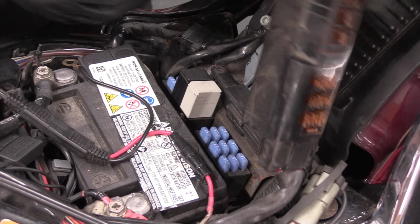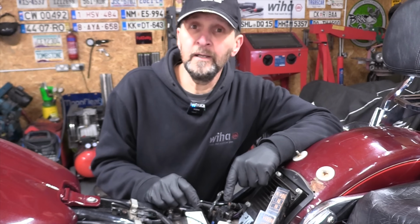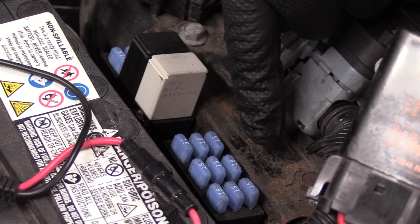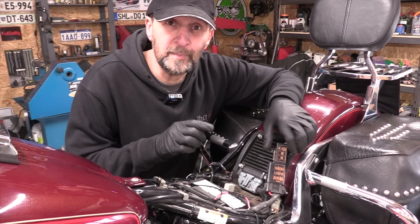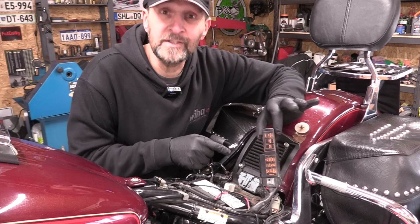Lift it up out the way. Now what we're looking for is the bike's main fuse, and it's not in there. All we've got is 9 15 amp fuses for all the bike's bits and pieces, the horn, the ignition, the lights, etc. A starter relay, a system relay. It isn't in here because being such an important fuse, it's safely hidden in here, inside the lid.